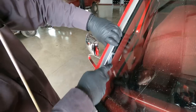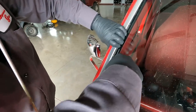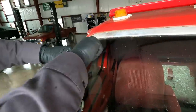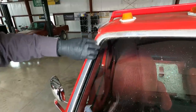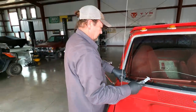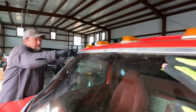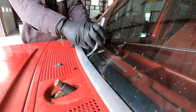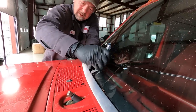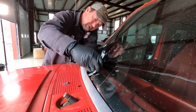This truck's had a windshield replacement before — you could tell; it wasn't Ford glass in it. That being said, when you replace a windshield that's been replaced before, sometimes you never know what you might run up on. They might have improperly glued the trim down right here. And of course, all the trash, twigs, et cetera, get under there so you can't get to what you need to.